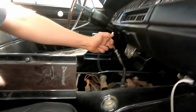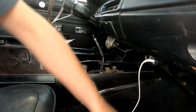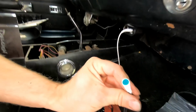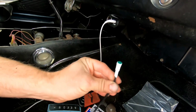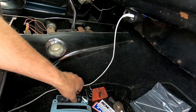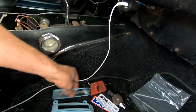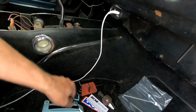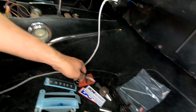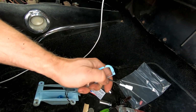We're just gonna put the button right on the front of the shifter handle. So I got the console all blown apart. What I'm gonna do is put my light indicator to let me know the line lock is on and functioning. I'm gonna put that into the illumination part of the shift indicator lens. So I'm gonna drill a hole, then drill a hole in the backing so that way it lights up the top of my lens green. Should be pretty sweet looking.